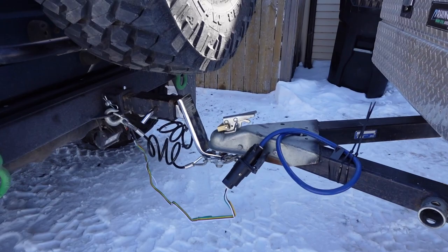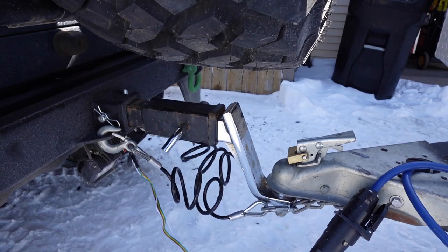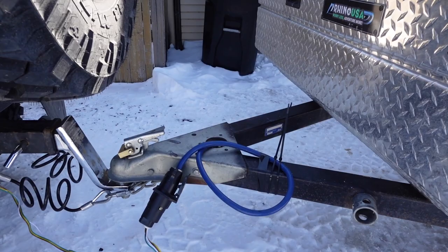In order to make the 7-pin work I had to wire that up just to get it home — kind of janky how I zip tied it. But I also had to have a little extension. One of the things I am going to be doing is putting a max coupler on, so this will be cut out and we are going to extend the tongue out a little bit.